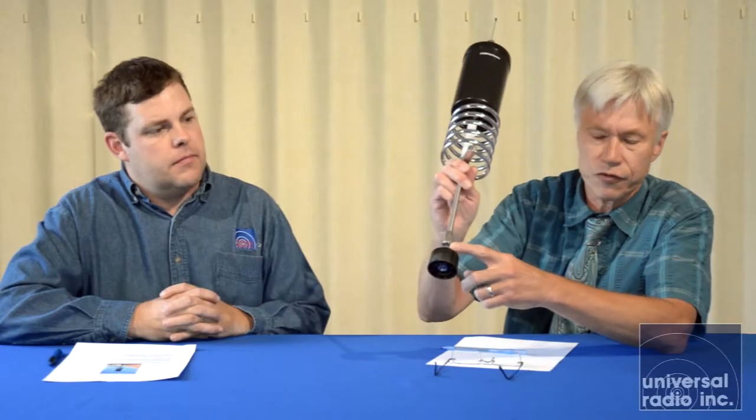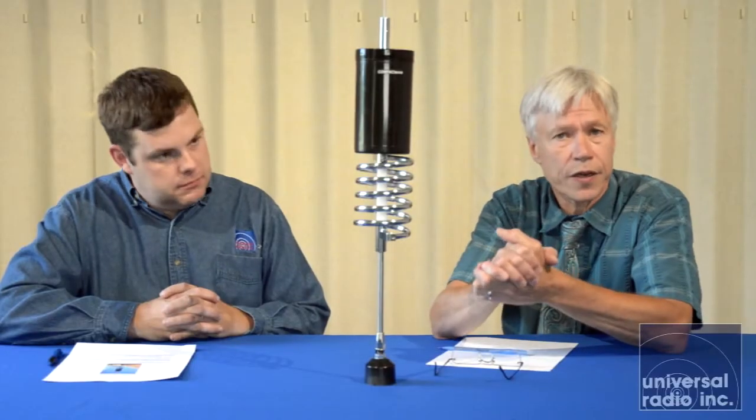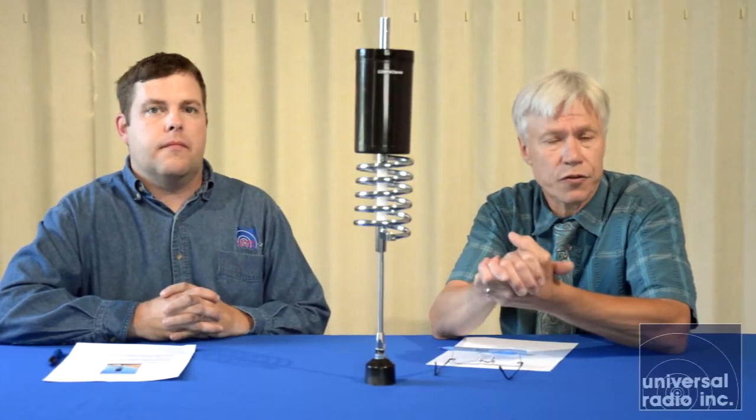It's a rugged design and does require a rugged mount. This one is a 3-8-24, a very standard and very rugged mount. It includes a stainless steel lock washer. A variety of rugged mounts are available at Universal Radio, Universal-Radio.com. It is recommended for best SWR to mount your rugged mount at or near the corner of the vehicle, and that is described in the data sheet.